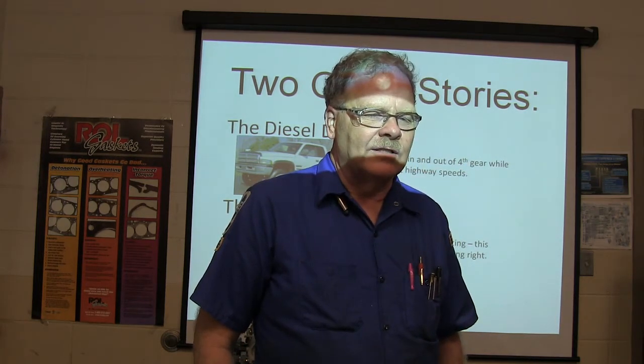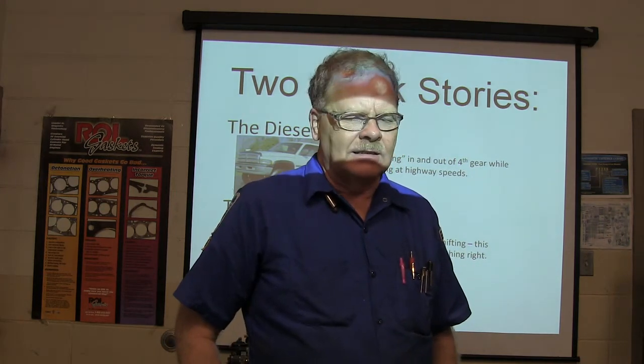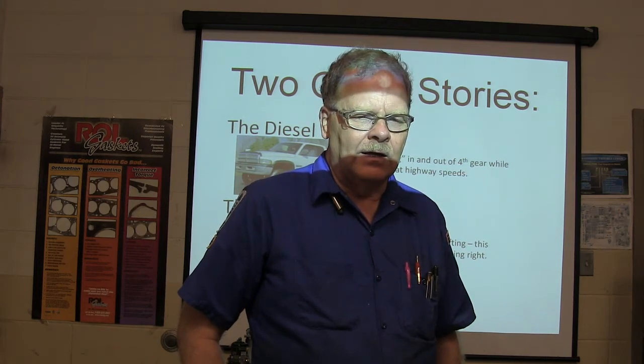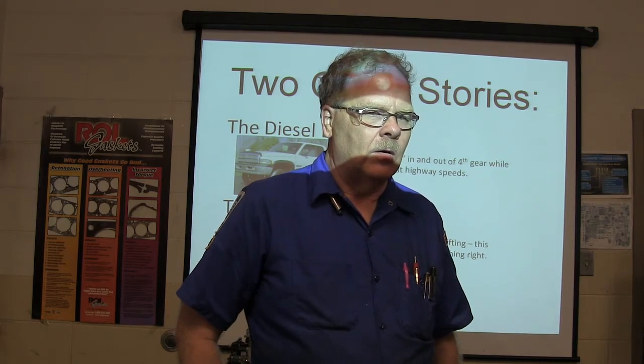And I got to noticing when I got in there that some of the warning lights on the dash didn't work. And I said, did you notice some of these warning lights didn't work? He said, what's that got to do with anything? I said, well, how does it know it's in four-wheel low? Oh, no, let's research that.